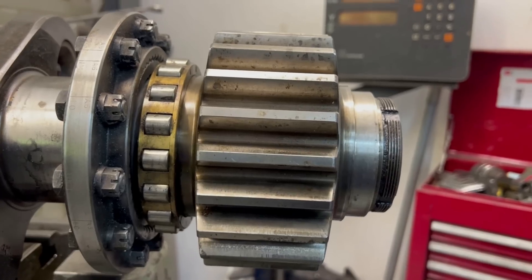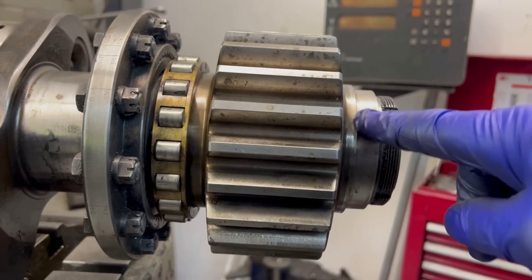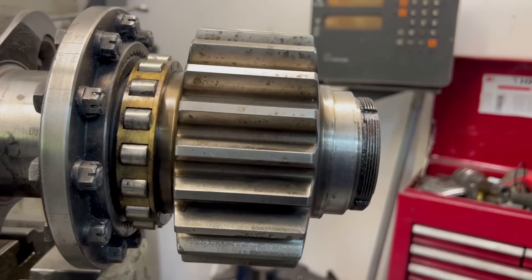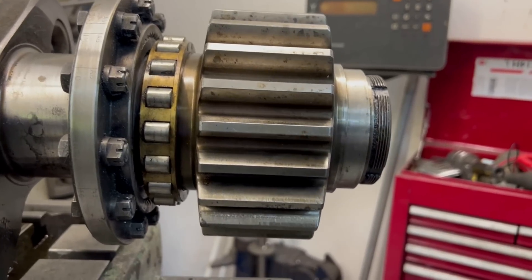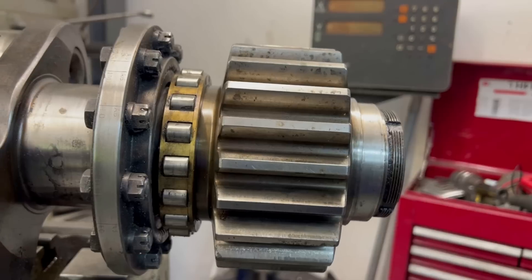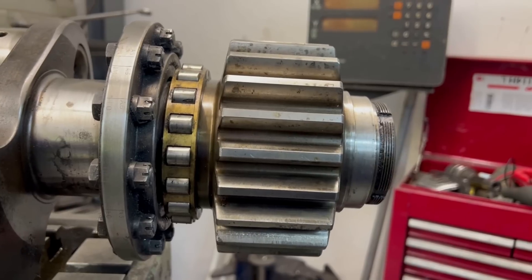They were able to prevent the coupling from pushing back on the crankshaft by maintaining the front of the pinion 1.5 thousandths of an inch higher than the back — which is about 0.04 millimeters. This was achieved by drilling out the dowels in the joint between the casing and the crankcase and, if necessary, putting larger dowels in so that once it had been repositioned it would always go back in the same position.